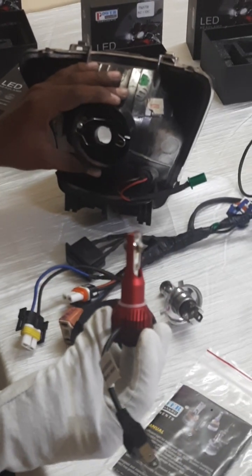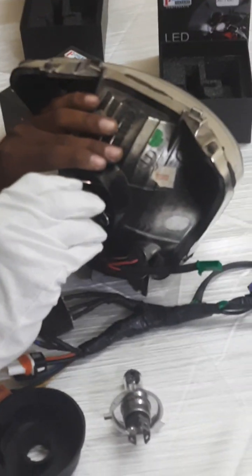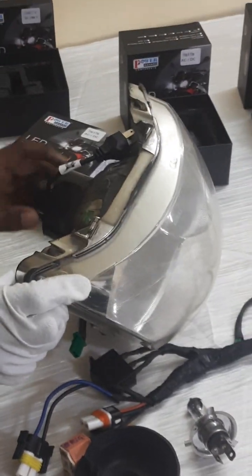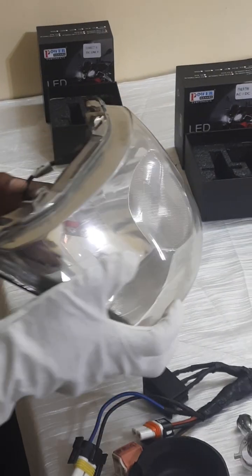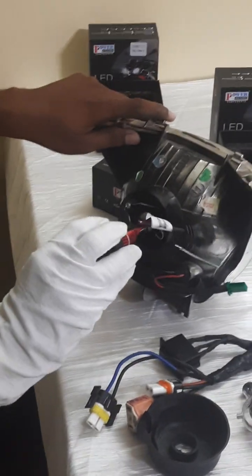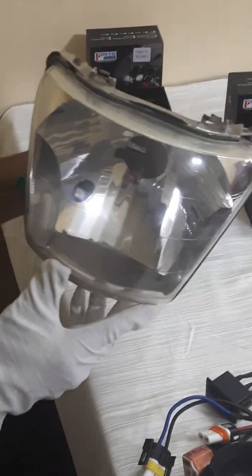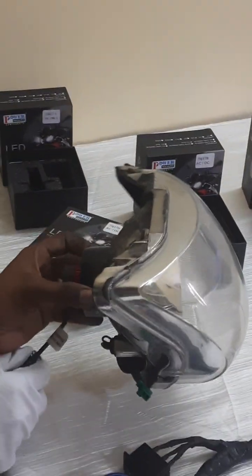Insert the LED bulb body into the grooved track given in the tubular area of the collar, and turn right, till the bulb light spreading plate comes to the bottom horizontal position as shown in the user manual, in order to get a perfect beam pattern and light spread.